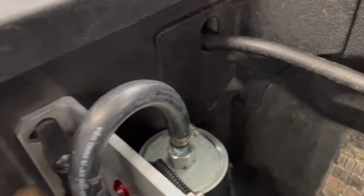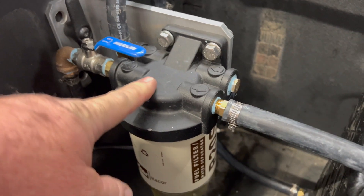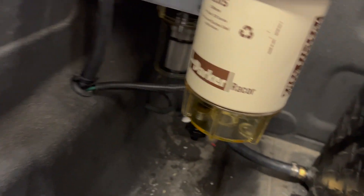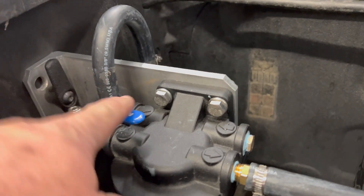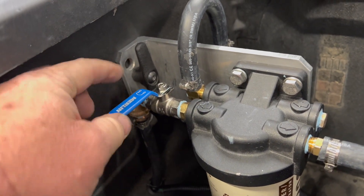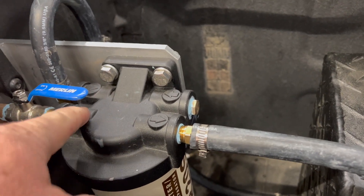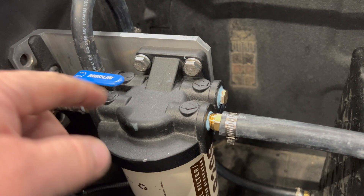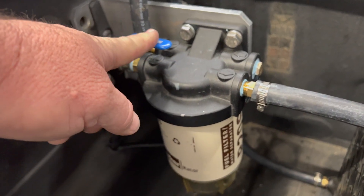On the back side we have a marine diesel fuel pump that has an 80-micron stainless steel filter in it. It comes from the main tank up to the pump, from the pump into the filter housing, through the filtration system which includes a water separator so you can see if you have any debris. Then there's a stainless steel ball valve — when this is open it will flow fuel into the main tank on the truck while you're driving.